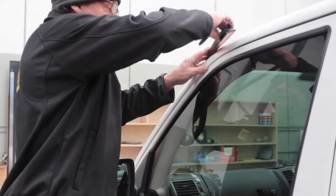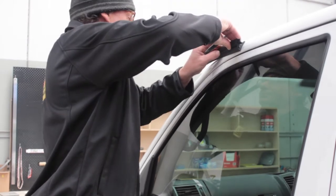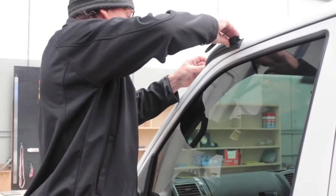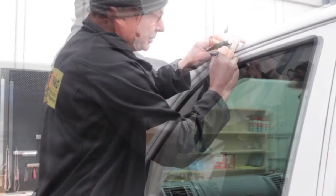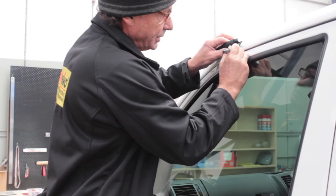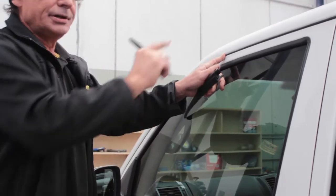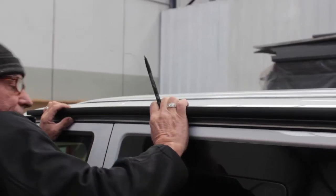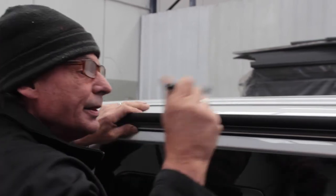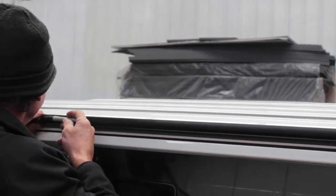Where we're going to have it sitting, because this does 2 jobs. One, once it's fully fitted, for the water to flow down onto the windscreen. 2, to give us a correct position for the Multirail. Put a line on the body, like so, and that gives us our marking point then for the Multirail. Rail up with the line that I marked at the front. Then I'll come down to here. Okay, I'm just marking the middle hole, so I can put in a pilot hole.